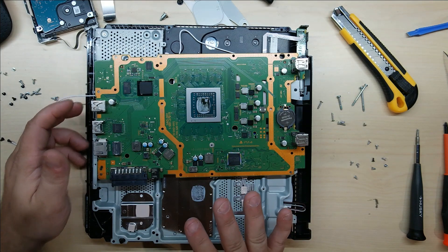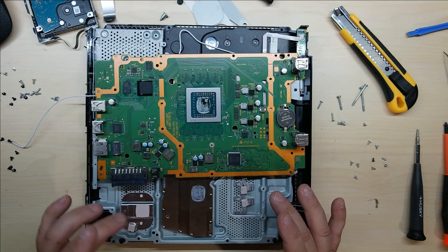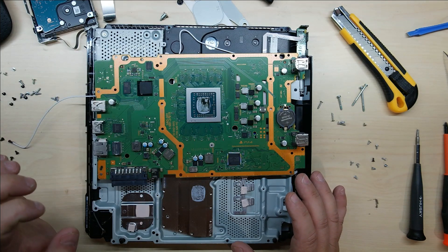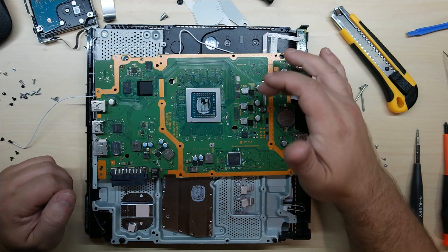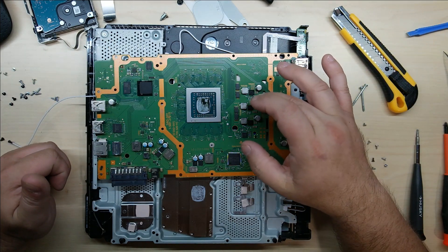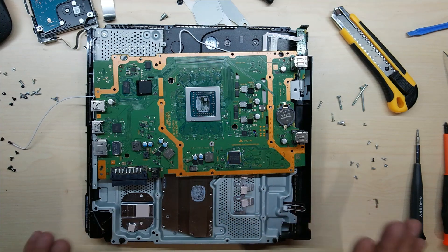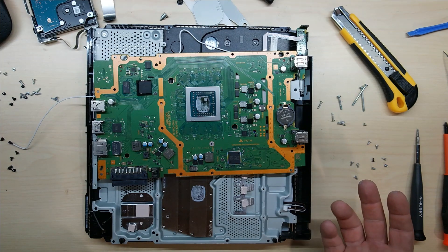There's no dust underneath here. We have a few thermal conductive pads for some chips — you can see silicon leaking out of the pad around one chip here. Looks like we're also cooling another chip down here, and also the VRM — three-stage VRM. They're cooling those right here as well, and they're using this main piece of metal also as an additional heatsink. So let's repaste this, flip it back over, blow the dust out.